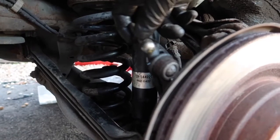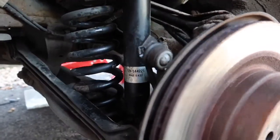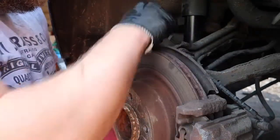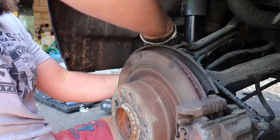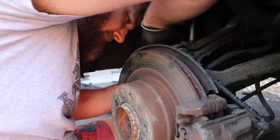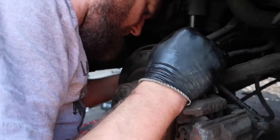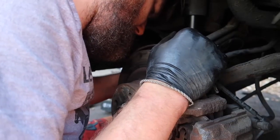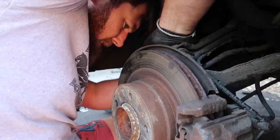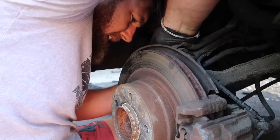This should be attached inside there, connected to the rear anti-roll bar. Now what the spanner is attached to, the nut, is the drop link to the rear hub. We're now just going to slowly work it out, and I mean very gently. The rear anti-roll bar is actually getting in the way a little bit. It is coming free. I don't imagine it being too long. Actually, in this hand that you can see, I'm holding the roll bar out of the way, and then slowly making sure my spanner's on straight, working that there.